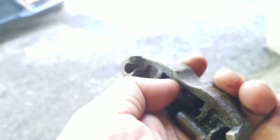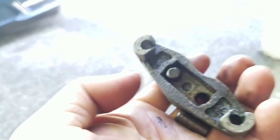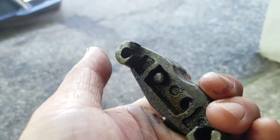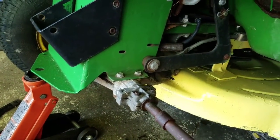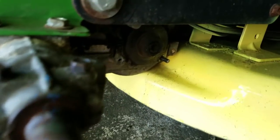Now I think the brake pads will be pushed, you know what I'm saying? Before they weren't even being pushed, that's why. So that's the fix right there, you know? The pistons were seized. Problem is, though, I still have that stripped bolt there. I don't know how I'm going to secure the caliper onto that stripped screw.